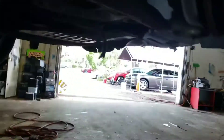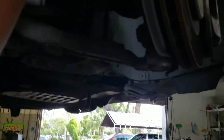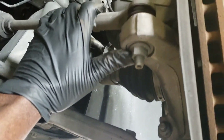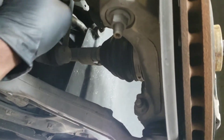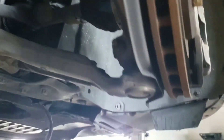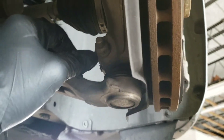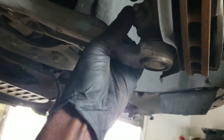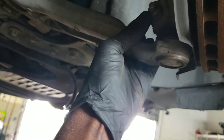What I'm going to do in here is take off the tire. Then it's going to be 18 millimeter, and I'm also going to take off this right here and drop it down, push this down so I can get room to take out the CV axle.